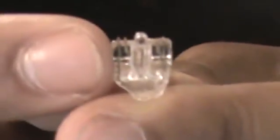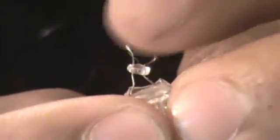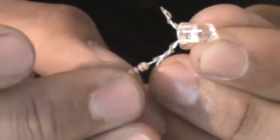Another component you'll need is this crushed bulb. After putting the bulb under a little towel and crushing it, what's left are the ends that were connected to the motorcycle — and on the other side, this is where you're going to be connecting one end and the other end of the setup. You'll also need your one kilo-ohm resistor, and of course your bulb indicator cover. What's going to happen is you're going to connect the resistor to one end of the LEDs, soldering that together into place. You're going to wire the resistor end to one end of the bulb, so it'll connect on one side, and then the other end on the other side.